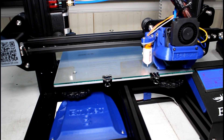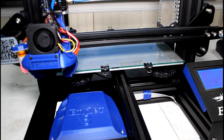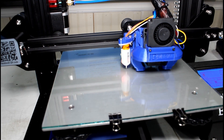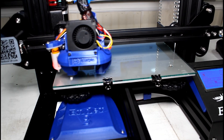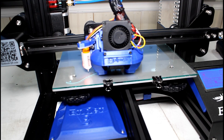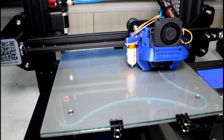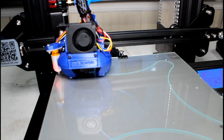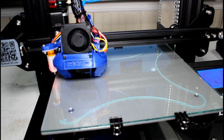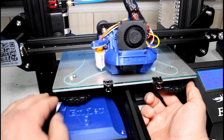When you're back at the front right side for the second time and click to resume, it's actually going to start printing. It'll do a test pattern about 0.2 millimeters thick, going all the way around the bed. If everything goes right you should see it sticking to the bed. If not, loosen or tighten your knobs while it's printing. If it's coming loose, you're still too far from the bed — raise the bed just a little bit.